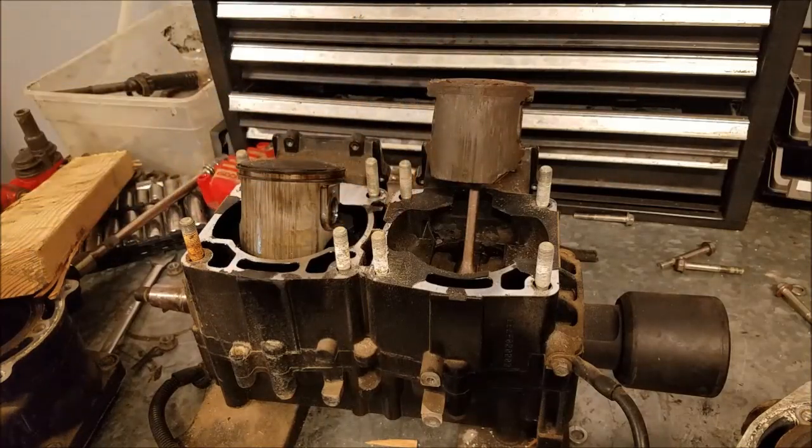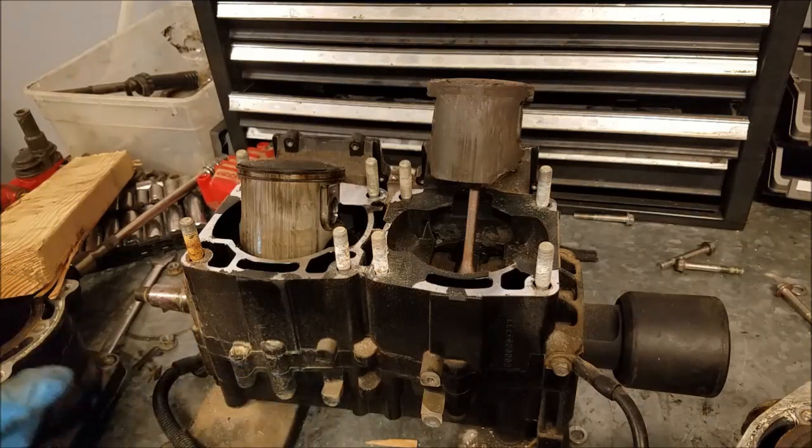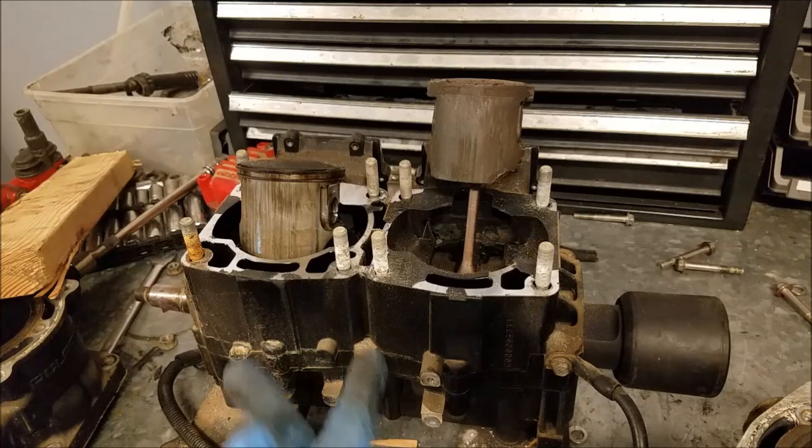And as you can see by the discoloration, this thing got quite hot. Personally, I don't believe it's a cooling issue. The jet ski's cooling system has a little pickup at the end of the jet — so when the jet is on and the engine is running, it's forcing water out, getting into the pickup system and going through the engine. The only way to really lose cooling would be a pinched or missing hose, or a broken plastic connector. I don't believe it's a cooling issue — probably an oiling issue. Chances are the auto-mixing oil pump failed, or they didn't have oil in it and ran it anyway, causing this kind of damage.